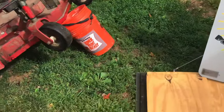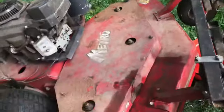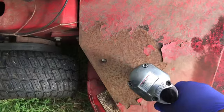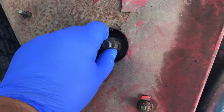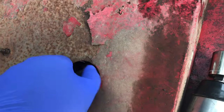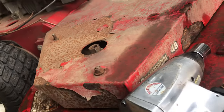All right, now that the compressor is full, turned off, you're gonna come over, make sure you got the blades locked. Put this bad boy in reverse, obviously. Hold on a minute. And we're gonna back these nuts off. Give it a quick shot. Once it starts to spin, you gotta be careful because you have washers in here. You don't wanna lose the washers. So you take the nut off, and before it comes totally apart, you're going to reach under with your other hand and grab the blade so it doesn't slip and fall all over the grass. See if we can position this somehow.